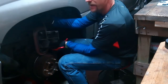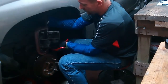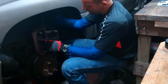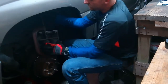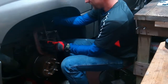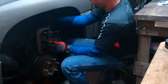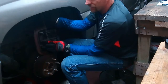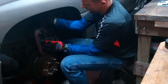I did this as soon as I noticed the metal-on-metal noise. Some people will ride on it for a couple of days before replacing the pads — and if you do that, the friction heats up the caliper and warps or seizes the pistons. So if you run it hot and then try to compress the pistons during the brake job without replacing the caliper, you're likely to have a sticking caliper shortly after, which is much worse. So address it right away.